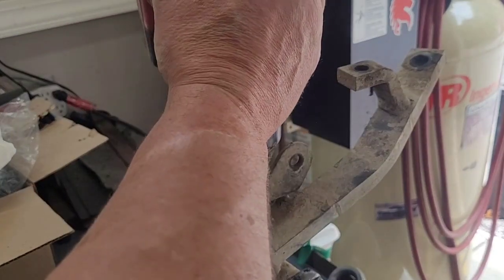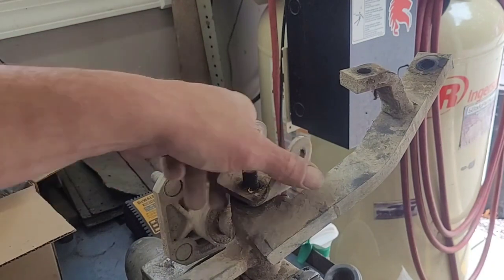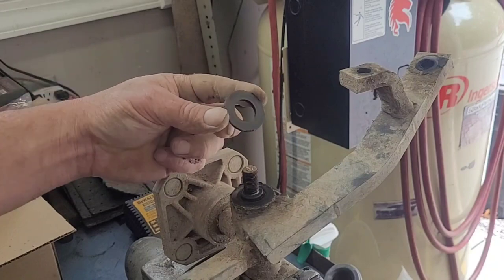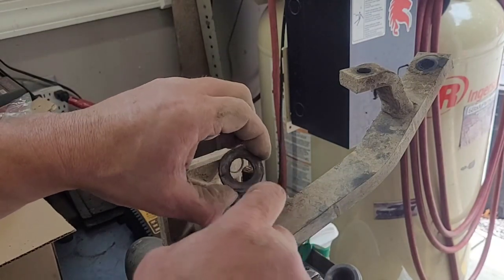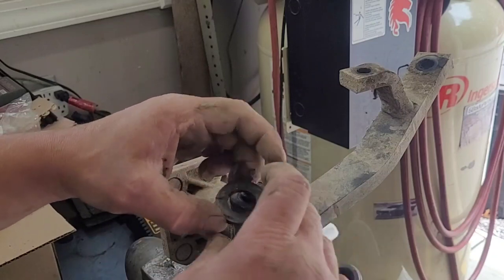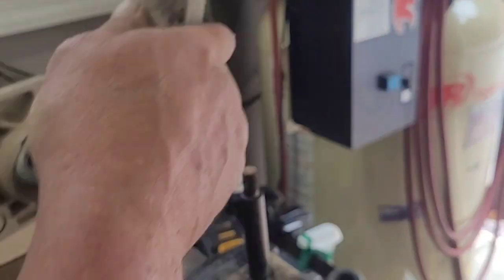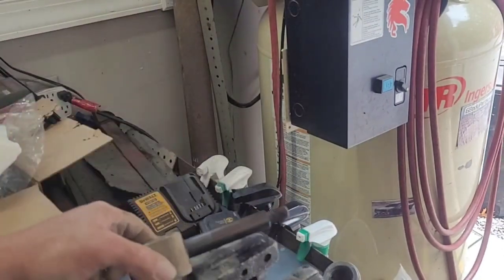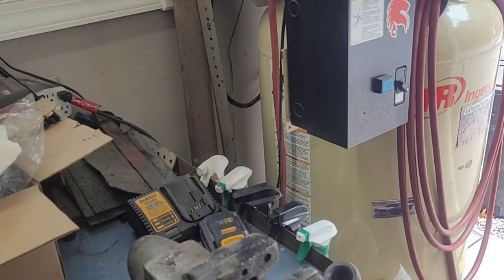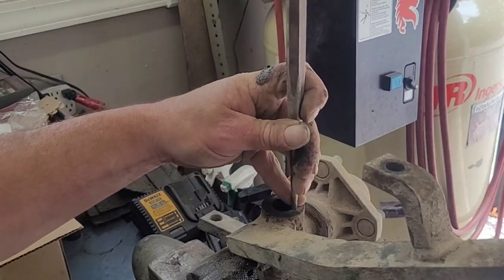With the setup on the bench, let's get the right side socket first and add the impact. That's a heck of a nylock. When it's pulling apart, you can see this washer — there's a groove on it. I wonder if it was assembled the right way up — we'll find out. Spindle's off. Here's the old kingpin.